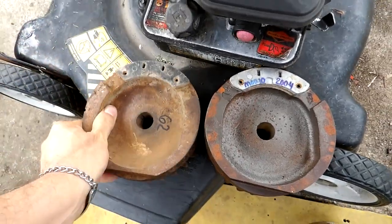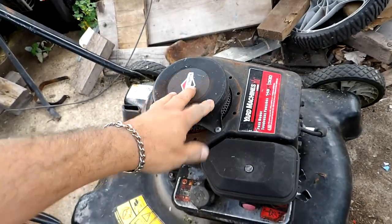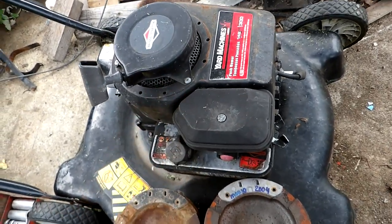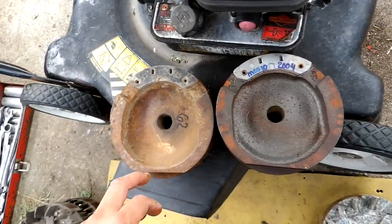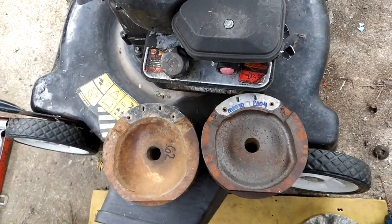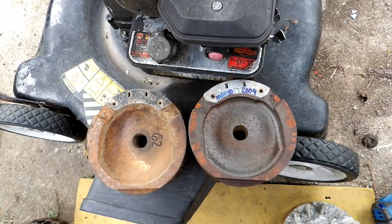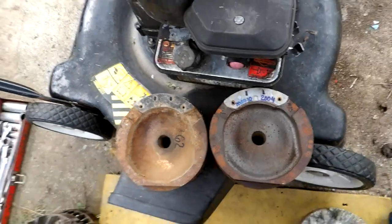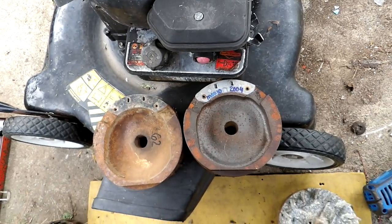Flipping them over — this one was actually off a Briggs Model 10, basically a four-horse push motor. It looks pretty much similar to this push motor, even though it's on a pressure washer. One thing I discovered with these — even though they look very similar — the newer one, if you install it on an old motor with the points cover under the flywheel, something in here will rub on the points cover. But if you remove the points cover and run an electronic Magnetron ignition, it would indeed work.